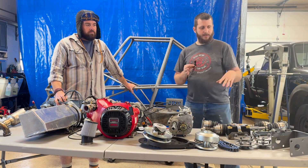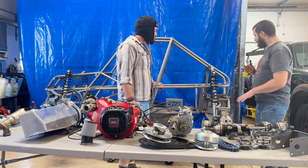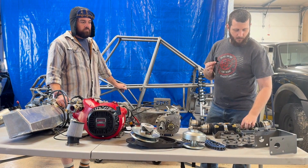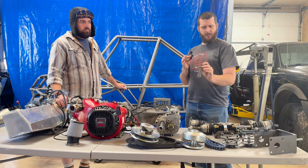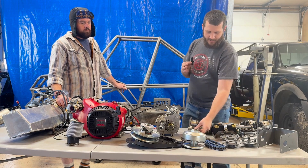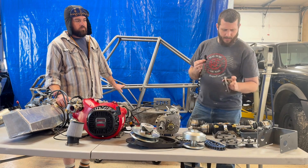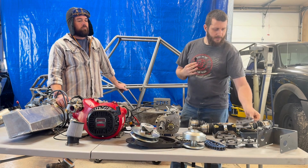On the back end, we have all the components of the drive box. The box on the outside will allow all the suspension arms to mount to and articulate on, giving it a solid structure. On the inside, we have the actual carrier that will have the pillow block bearings bolt onto, which will hold our center drive spline shaft — I think it's an inch OD shaft — and it is dimpled for the hubs. There are two smaller hubs on the inside of the carrier: one for our chain sprocket and one for our inboard-mounted brake caliper. On the outside are some homemade hubs — these are for the Mazda Miata mounting flanges — sprocket hubs with plate steel welded on and weld nuts welded on the back to bolt the axles on.